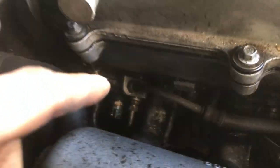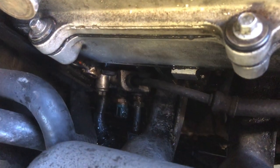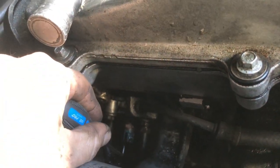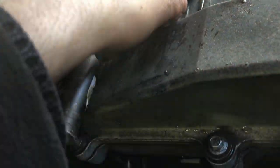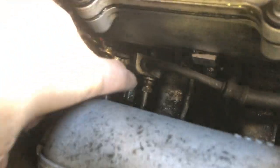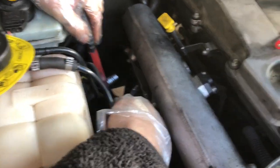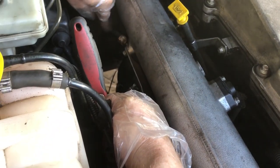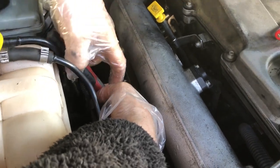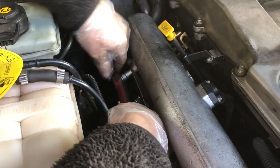After cleaning it up, the first thing we've removed is the sensor wire. It's a multi-plug with a little metal bracket either side - use a tool, put it down in there and hook up and it'll come off. There's a little retaining spring, then use some pliers to pull it off. The next things to remove are the pipe connections. John is now going to remove this bracket - it has two 10mm bolts - which holds the fuel line connection.